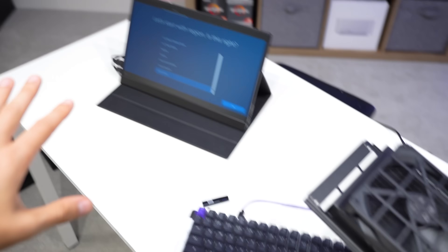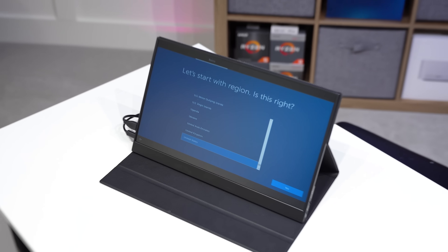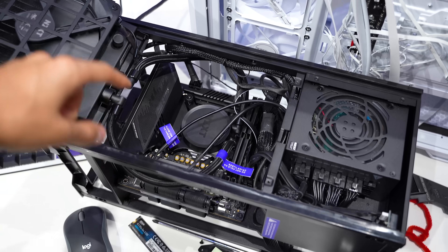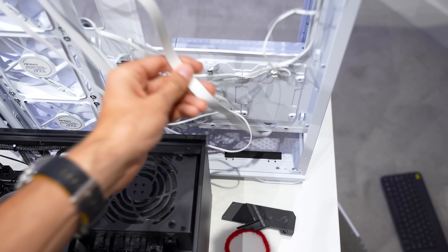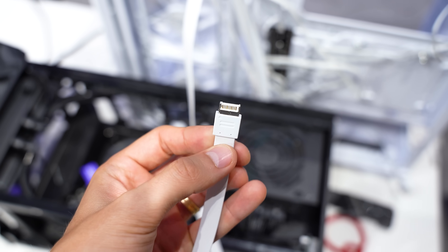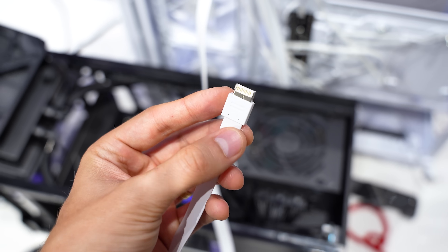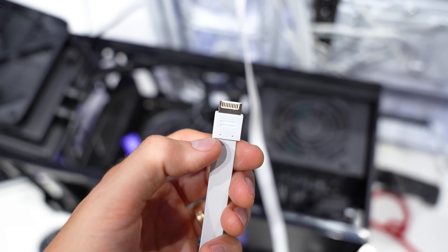All right. So the system as-is loads up repeatedly into the Windows home screen for first-time setup. That's exactly what we want — and this of course is with the USB-C cable disconnected, but everything else is plugged in where it should be. Now what I want to do is turn the system off and connect another USB-C cable — this one from Antec. It's the same connector, just this one's white. And I want to see if we can get the same overcurrent notification with this one connected. I know this one is okay because we've gotten a system to POST with it connected before.